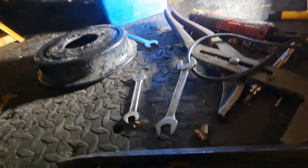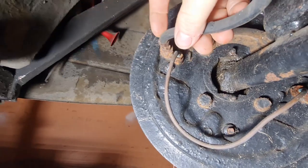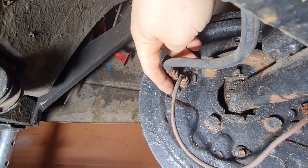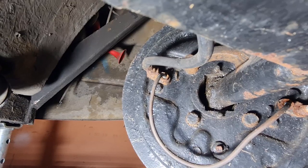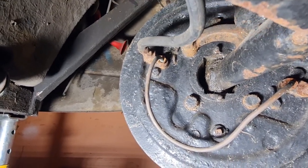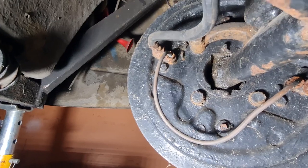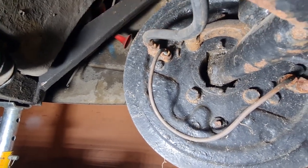I'm going to get up under here and undo the flexi hose off of here, then undo this brake pipe. The wheel cylinder itself is held in by two bolts - I'm not 100% sure what size they are at the moment. Then we can hopefully swap that out without taking anything else off, and obviously we need to re-bleed it after that. We'll check the back ones first before we start bleeding anything. This one that moved was the one with no rust or corrosion, whereas this suspect one looked a bit manky before we even touched it - that's the one we're going to change.